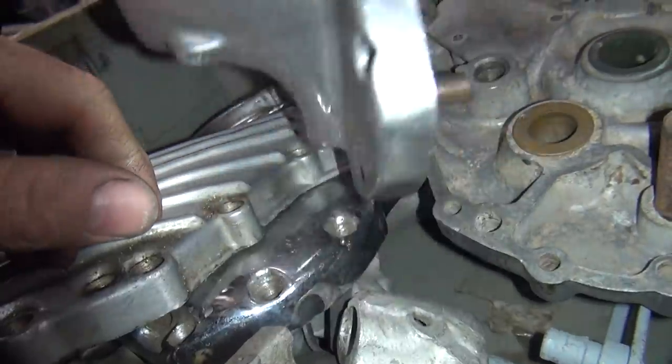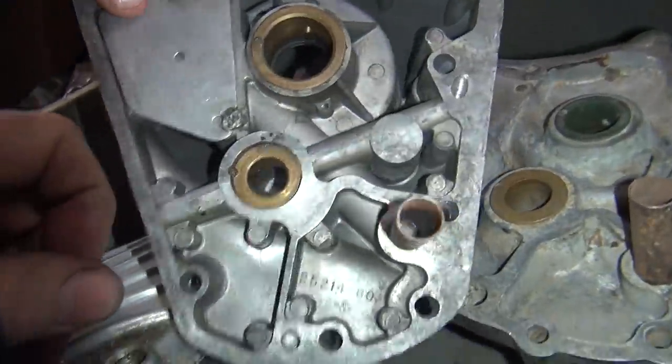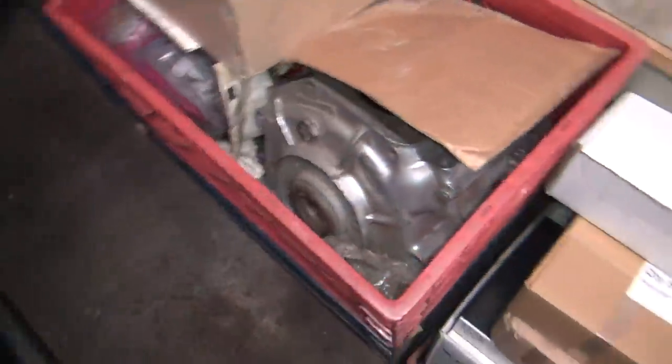These things all have breather cavities. That's what they do - they plug up full of oil, that's why they're going to pump oil out until they equalize. The breather tube goes on the side of the case - it takes two halves to make a hole. Now we have to go to a different area because we're running out of parts here, so I'm going to find a case laying around someplace convenient nearby.